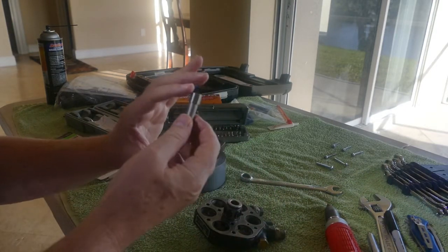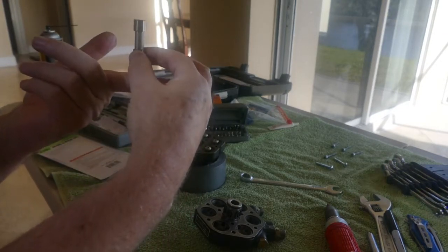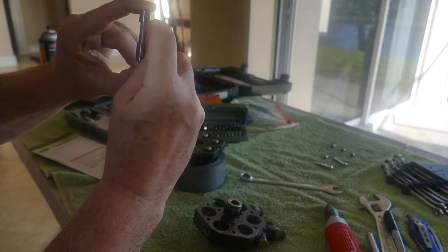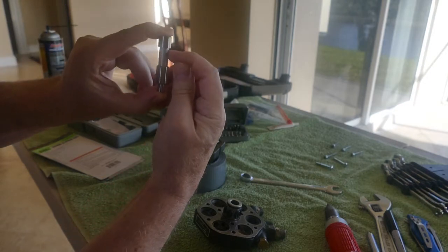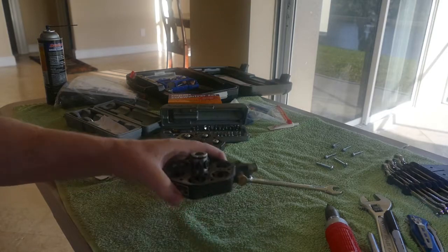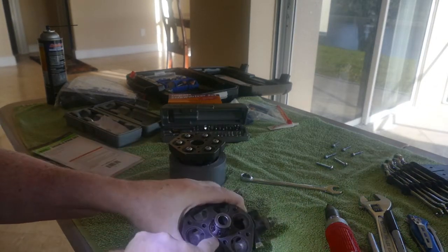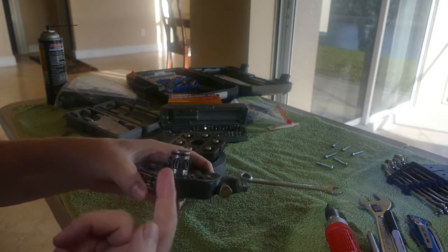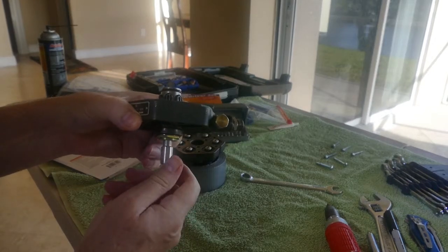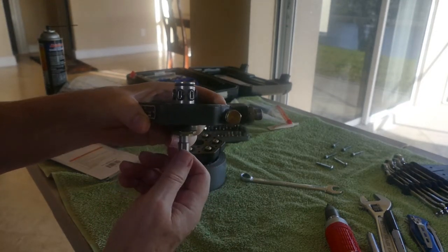The way this works: this plunger, when you put on the throttle, makes a plate raise up which pries this up. Fuel can go here but can't get out because this is blocking it — but when it pries up it allows the fuel to go up. The fuel goes in this hole at the bottom, through a filter — you can see the brown filter right there — into the center post, up and out these ports. There are six ports, one for each cylinder. This piece fits up in here: if it goes up you go faster, if it goes down you go slower.